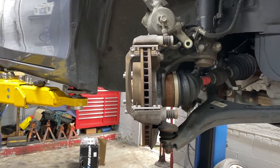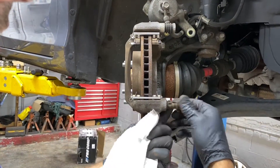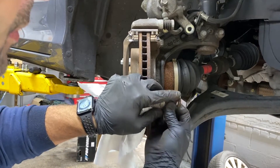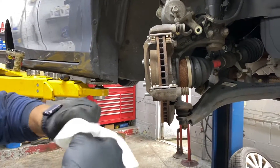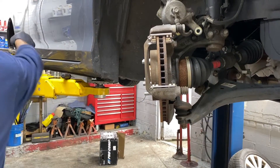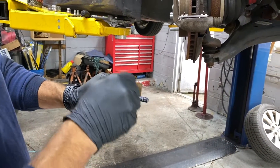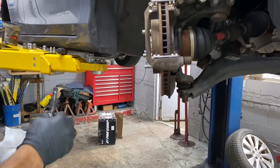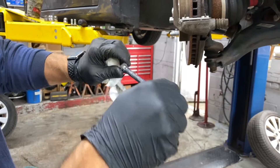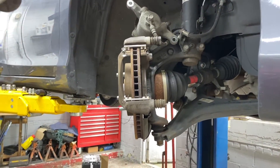You've got caliper grease — always grease the calipers when you do a brake job. Pull these pins out, but don't tear the boot. See that boot right there? That's what keeps the dust out. Hold them out nice and clean — fresh grease has to be caliper grease because it gets really hot. Don't be cheap with the grease so these brakes function right. Both pins are in.